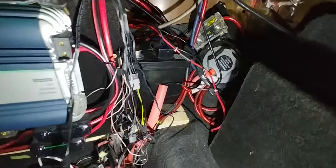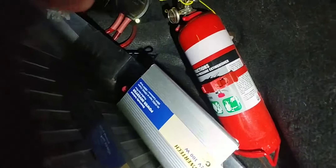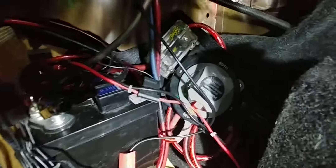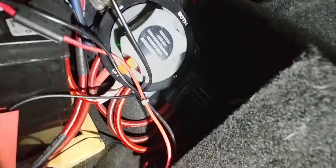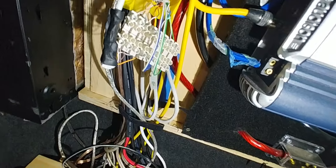This section on the right is the second battery. All the cords get tucked in behind this panel. There's also an inverter here I use when travelling, for things like drone chargers. There's a 150 amp fuse, and a battery selector so you can set it to off when working on it, or select battery two only, both batteries, or the front battery — so you don't flatten your ignition battery.